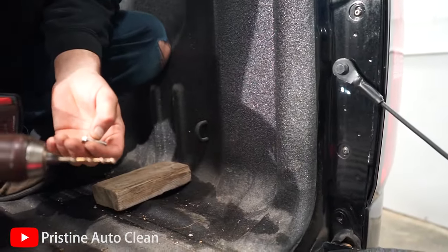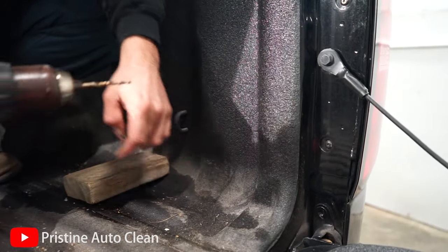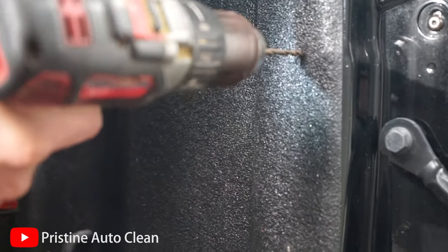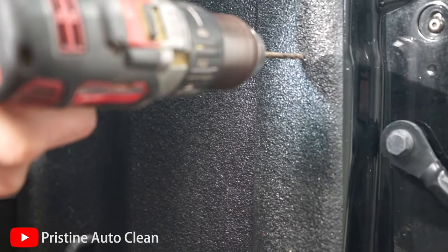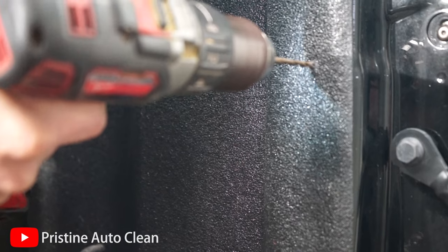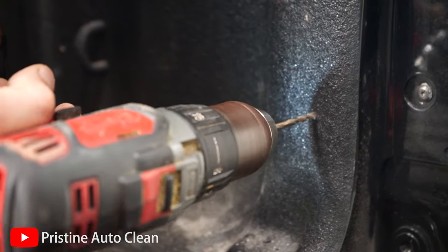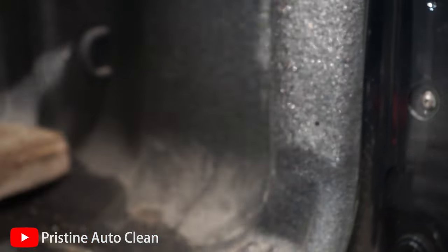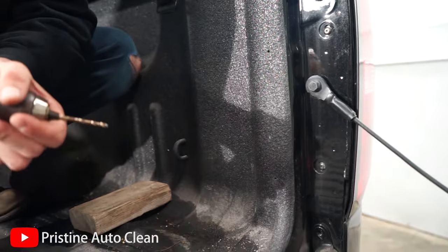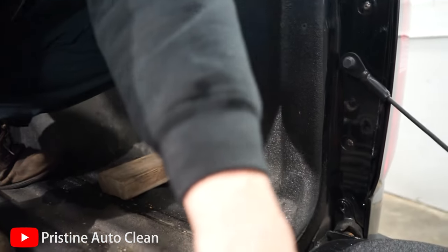For our particular kit it looks like it's a 3/16 self-tapper, maybe slightly bigger, so we're going to run a 5/32 bit after we drill our pilot hole. I'd rather go bigger and make sure this is a snug fit rather than go loosey-goosey right away. This is very thin metal — don't go yamming through it, you don't know what's behind it. There could be wires back there. If these don't grab we'll go to a 3/16 bit, but once you send these in too tight it's game over and it just strips itself out, so we're going to leave them snug.